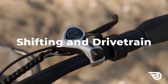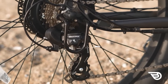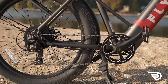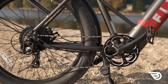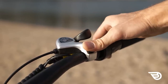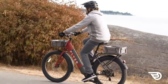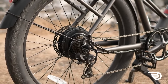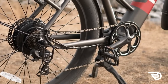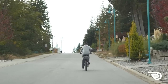Shifting is handled by a Shimano SL-TX50 7R shifter with a TY-300 rear derailleur and a 7-speed cassette. Up front you have a 44-tooth, 170 mm forged alloy crankset with a dual-sided aluminum guard. Shifting is clean and the gearing matches the motor capability well. At higher speeds you lose the ability to pedal effectively and are just along for the ride, but with the bike limited to 20 mph that's not an issue. The lowest gear tackles larger hills with minimal effort.